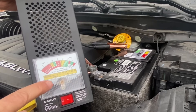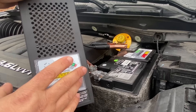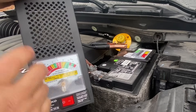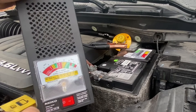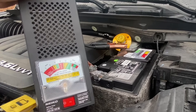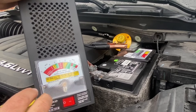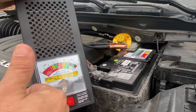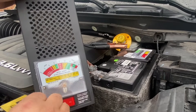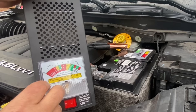The vehicle's computer is very sensitive and will pick up on a weak battery. It will not run the monitor test for the oxygen sensor or even the catalytic converter test. You could drive 100, 200, or even 2,000 miles and that monitor test is never performed. Then you start throwing money at parts — oxygen sensors, the computer, the alternator — people give you all sorts of reasons why your emission monitors aren't getting ready.